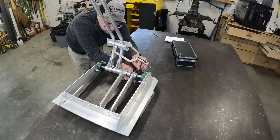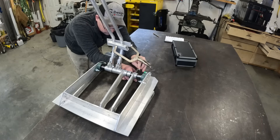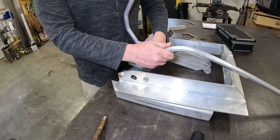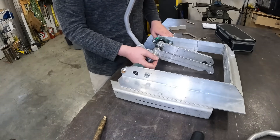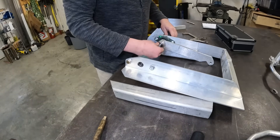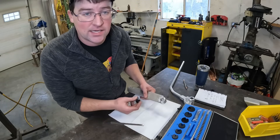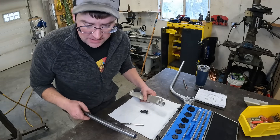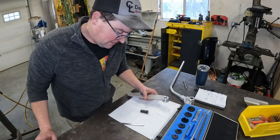With the controls back out of the snowcat, it's time to put some alignment marks on everything so I know where to cut the keyways, and then disassemble all this for what feels like the hundredth time. I don't think the key size matters too much here — we just want a really nice snug fit to take all the slack out of this control. My shaft unfortunately has some flat spots in it; I'm gonna try it anyway with this shaft, but I do have another one on order if I need to fix it again.